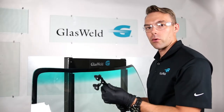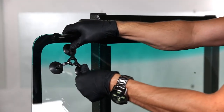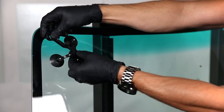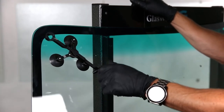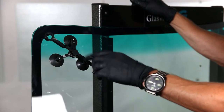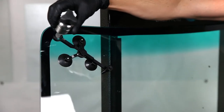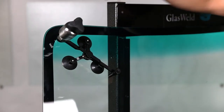If you have a break up in the corner, use the corner edge extension — it has small teeth on the edge and you click it into place. Give yourself a slight downward angle by threading the leveling screw. Once your zoom injector is loaded and ready to go, ratchet it into that area and get it to those one or two clicks once you hit the surface of the glass.